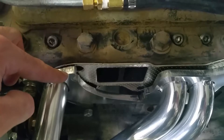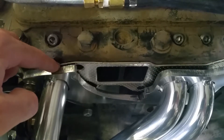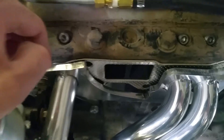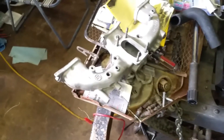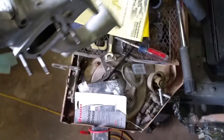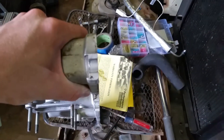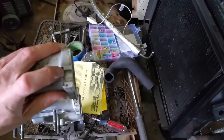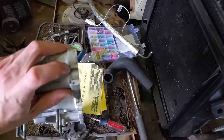It was way thicker. We called the company and they said they haven't really had any problems — maybe check what intake manifold you have. Sure enough, we grabbed another one of our intake manifolds from the junk pile, and this one is thick enough. It's like 10.3mm, and the other one is like 8mm, so it's about a 3mm difference.